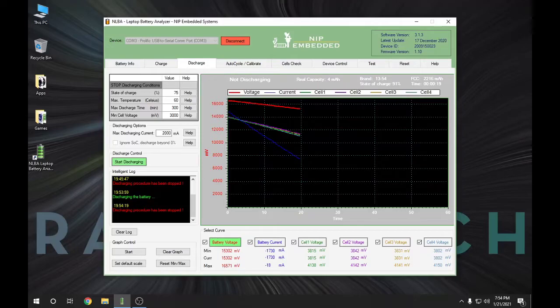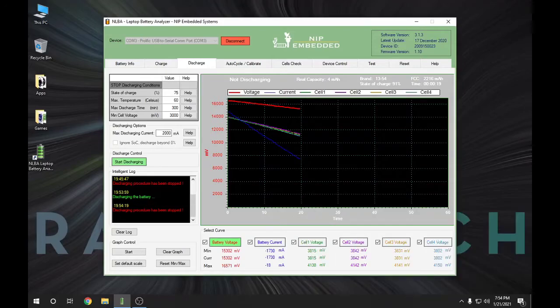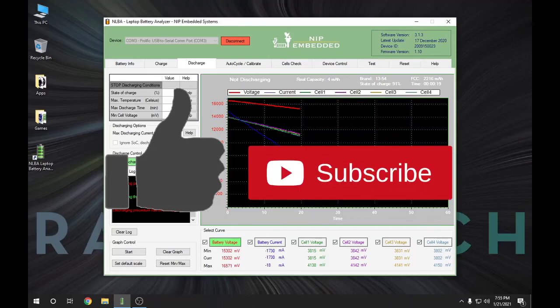If you check out something like this battery analyzer, it's definitely a cool piece to have in your toolkit if you're working on laptops. The reason I went to seek this out is because I work on Chromebooks, and students will say the battery doesn't work or won't charge. This toolkit lets me actually verify whether the battery is good or bad before I just swap batteries, and it's saved us a lot of money — it's paid for itself several times over by proving that batteries are actually good and not bad. With that, thank you so much for watching. If you liked this video, please give me a thumbs up and tell me in the comments what you liked or didn't like. If you enjoy my content, please subscribe to my channel and I will see you very soon.